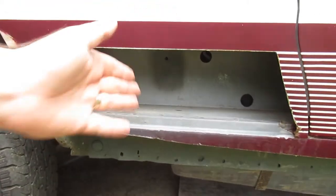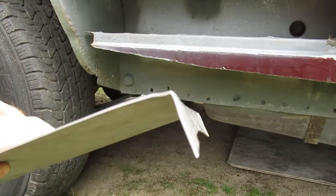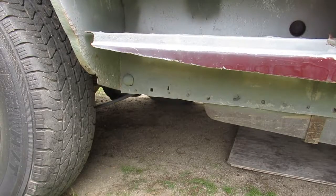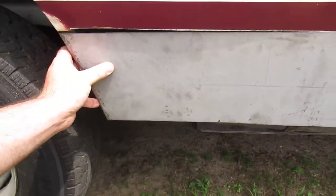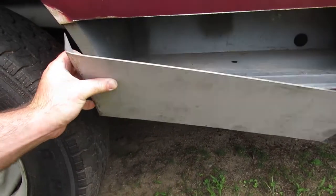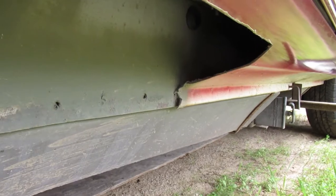This hole is too big — even a wheel arch would only go part way. So I decided to make a piece for it. This is actually my first attempt at panel beating. I used a piece of railway track to form it on and a shrinker stretcher to put the contour in the end. I made it plenty big. I originally wanted to rivet it on with brass rivets for a steampunk look when I was keeping the van, but now that it's being sold that's not going to happen. On the bottom you can see I cut out the rust and treated it to stop it.